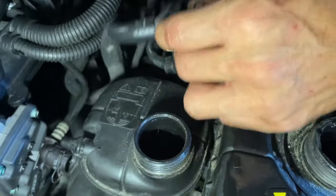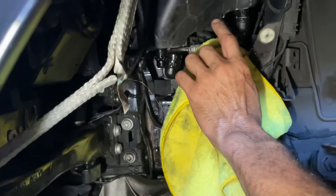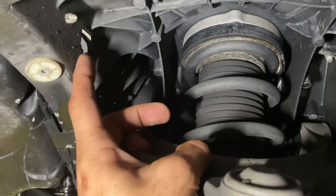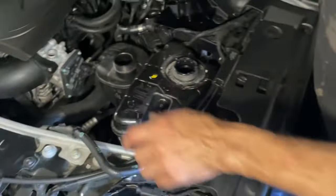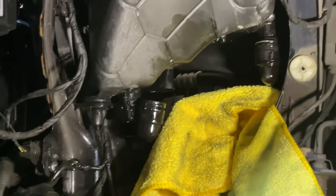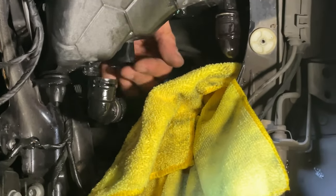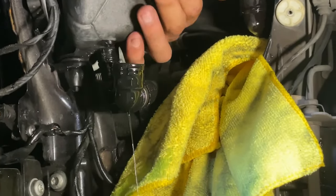Next step is very simple — you come back around down here. You'll see it's held in by this grommet. The little tank is connected to the big tank and the only thing holding it is this little grommet, and right here there's a little slot so when you pull up on the tank this slot will just come out of place. With all three lines removed, you grab under the big tank — you're gonna feel right where the sensor used to sit. Reach around the top, get a very nice grip. Feel the grommet with your fingers, then all you do is pull up.